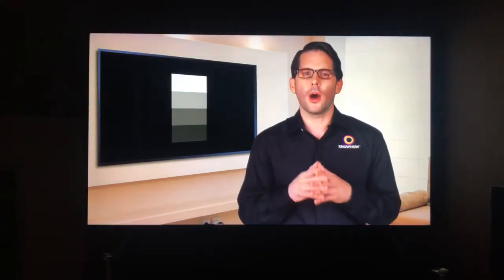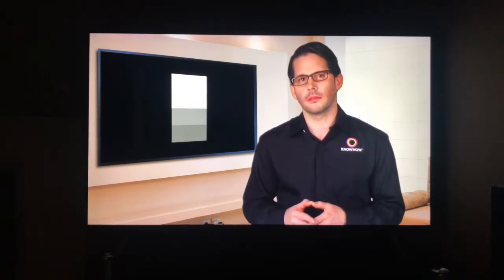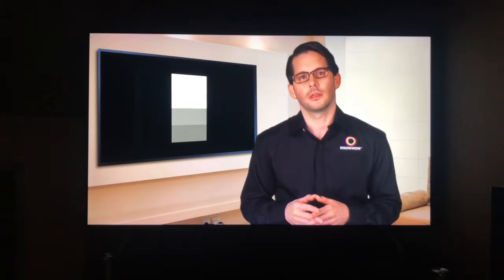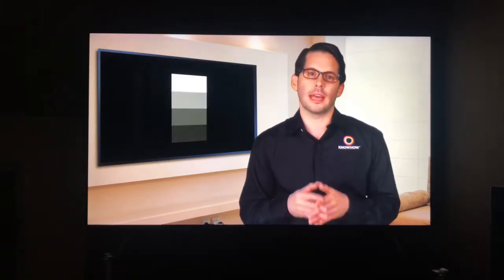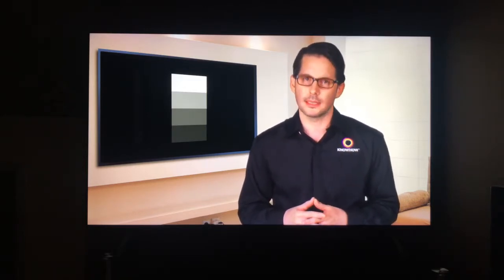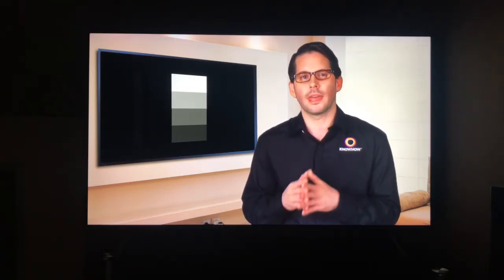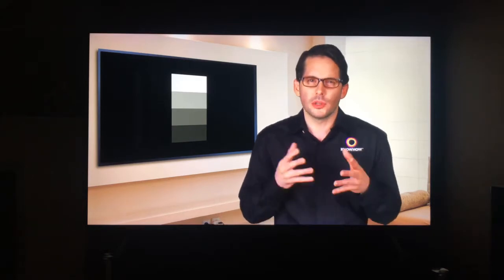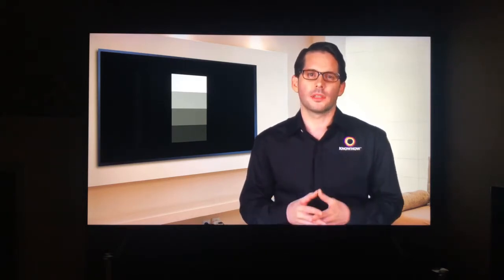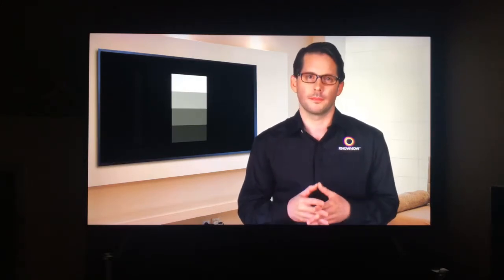Backlight controls how bright the lights behind your TV screen are. The higher this number, the brighter these lights will be, and the more energy you will use. The brightness is the amount of backlight allowed onto the screen itself. Maximum backlight doesn't make sense if you are running the brightness at a low setting. Ideally, you need to set your backlight to as low as you can without it seeming dark, but not too high that you let light bleed out of the sides of the screen. Somewhere in between is a good start point.